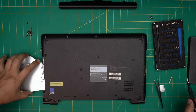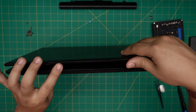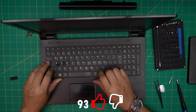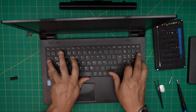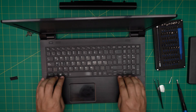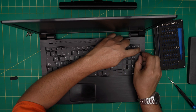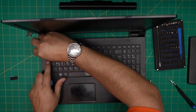Go ahead and open up the laptop to adjust the keyboard, and put the DVD drive back in. Run the cable right through here, slide the back end of the keyboard right under the palm rest, and hold it — put your thumb in the middle to create a slight curvature so you can snap the corners. Then let go and push the bottom side, hitting tiny clicks — that's what you want to hear. Use the guitar pick to adjust any spots that haven't seated all the way down.